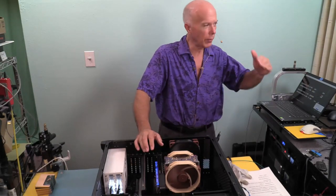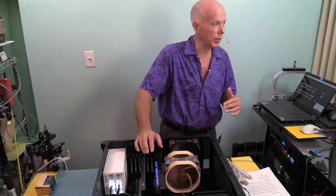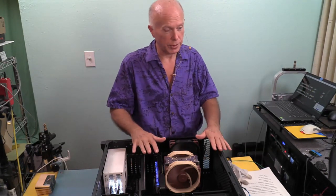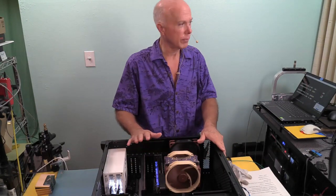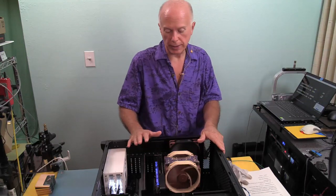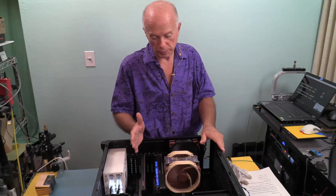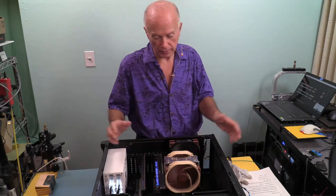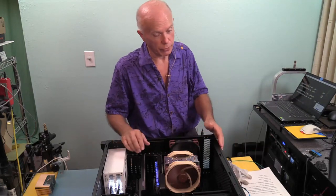We have stepped through with the F3 and with the F4C, and we are now running F4C. F4K is not stable. We're not going to use that. So we are right now on F4C, and it's lowercase c. It's a beta BIOS. We're waiting on this machine to boot. If it doesn't boot, we've got to pull the card out and figure out what's wrong, which means it doesn't like that BIOS. That's what we're trying to figure out.